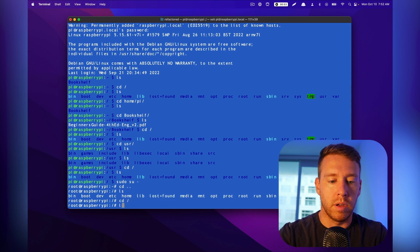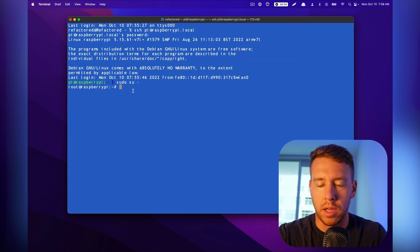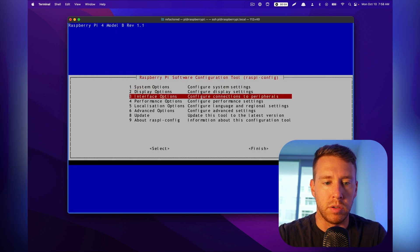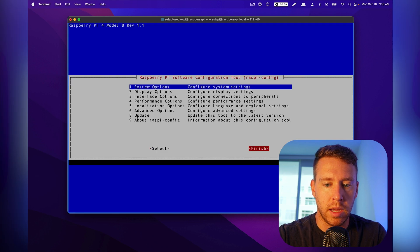So I can navigate to the home directory at /home/pi. Now let's go ahead and connect over VNC. VNC is served by a process that runs on the Raspberry Pi that we need to turn on — it's not enabled by default. So I'm going to run raspi-config, go to interface options, and then select VNC. Would you like to enable the service? Yes — it's now enabled.